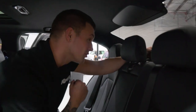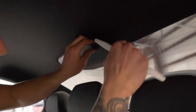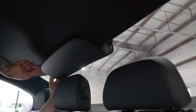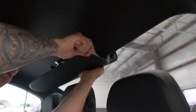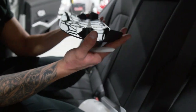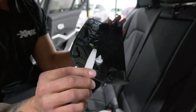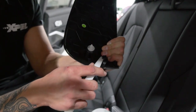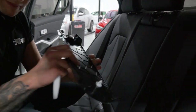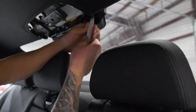Now I'm going to show you how to take out the third brake light on the 2020 BMW 3 Series. First, pop the cover off on the back — the clips closer to the front are a bit of a pain. The back clips go in and then the front pops up. To remove it, release the side clips — the white ones — get a gasket stick in there, pull from the front, and push on the little tab. Once you get that, pop the whole thing down on both sides and pull it forward. Then use your white stick on the side tabs and twist to release them, and the plug pulls right out — there's no pin on it.